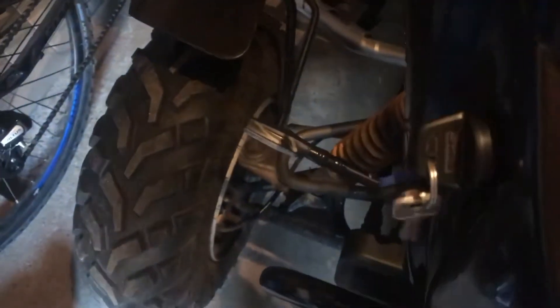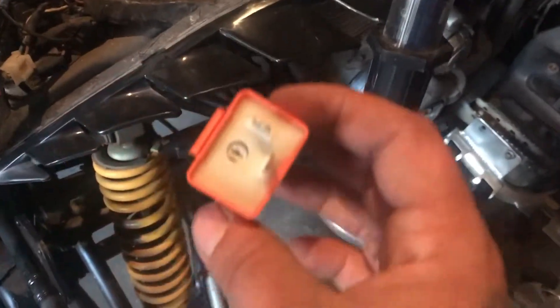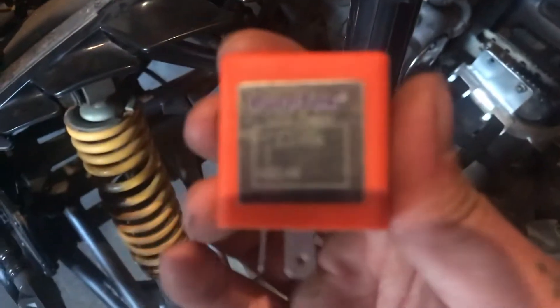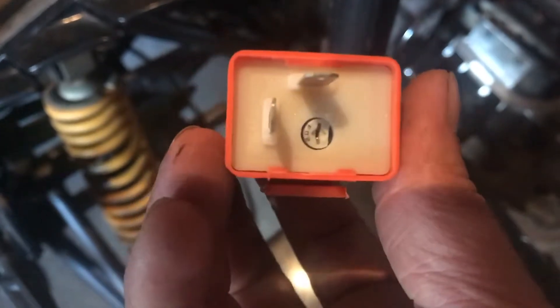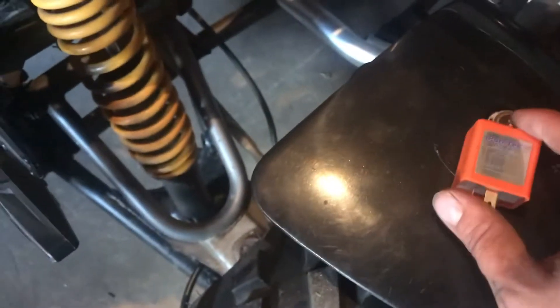They're already installed. It's just the simplest standard indicator cables — black and red onto your usual orange and green. Simple as that. The only thing you're going to have to change is a relay. Make sure you get an LED relay and make sure it's adjustable — if it's not adjustable it won't work.